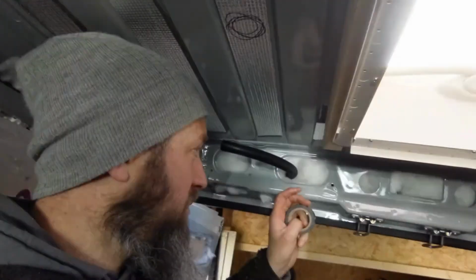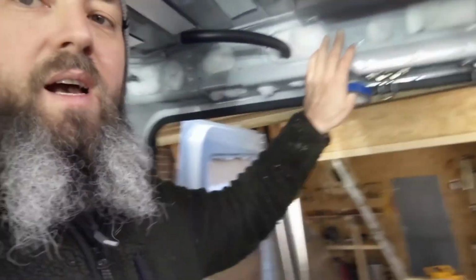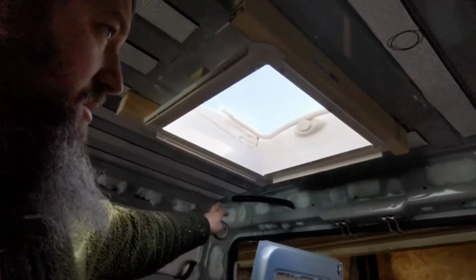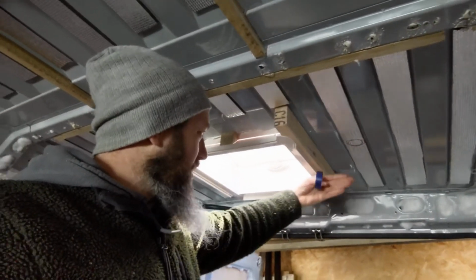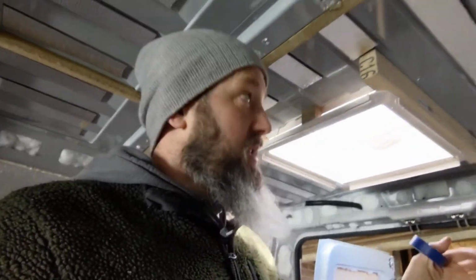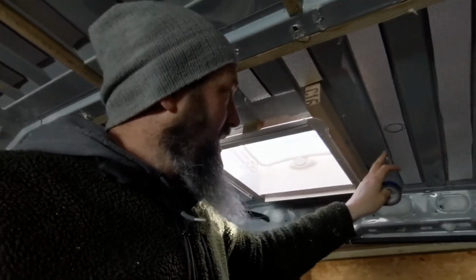To get the battens on the ceiling back here, I'm going to need to first of all fix a timber across the top of this door frame, and that's going to serve a few purposes. One of them is going to be to actually carry the ply that's going to make the secondary frame around the inside, and then the other reason is to help me to fix up these battens end to end and to get the insulation in.